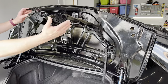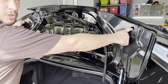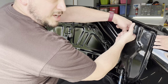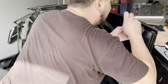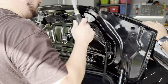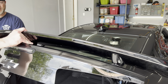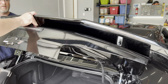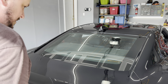Now that we've got the nuts loose on the inside and the spoiler itself loose, there are two clips on the outside posts that hold the spoiler in place. You'll want to grab one side and pinch it as you're pulling — it helps to have two people. Got it on this side. We'll angle this down so it doesn't drop. I'll hold one side while Matt pulls on the other. All right, we can set this down and lift the spoiler off.